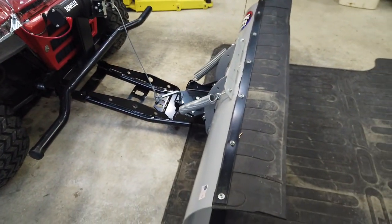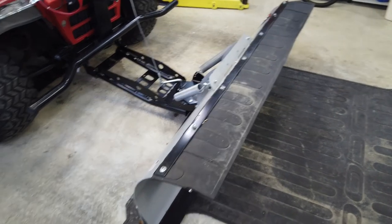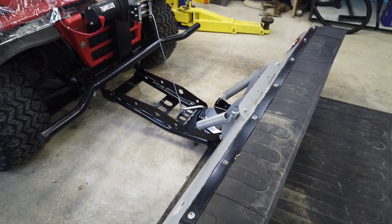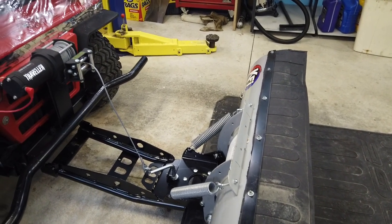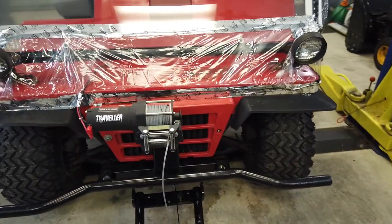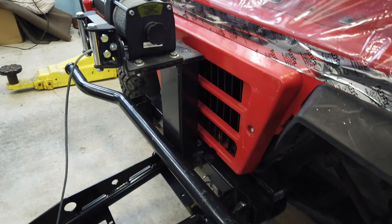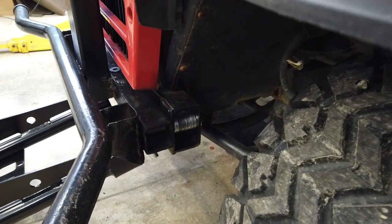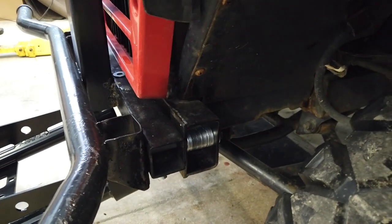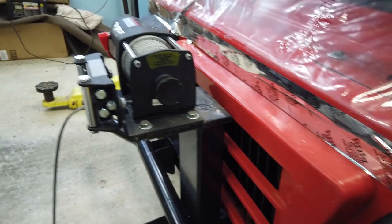As you can see, the plow I mounted. I had a bed liner so I made my own rubber flap for the plow, and got some metal from the local machine shop to make the top part. I fabricated the winch mount — I put a bracket on the old bumper, pulled it off, and had to put washers on the tube steel. That's my mount.